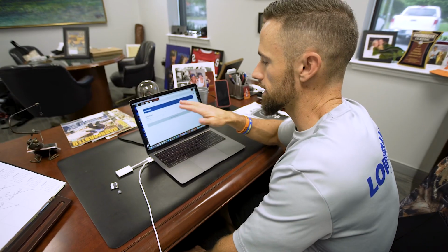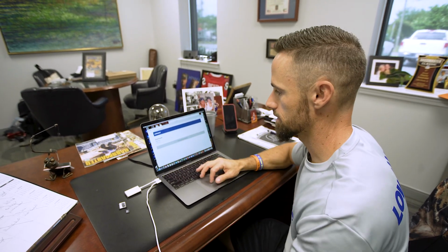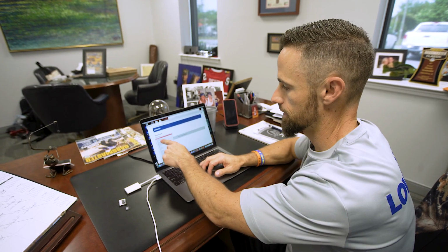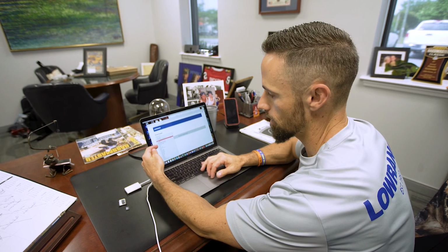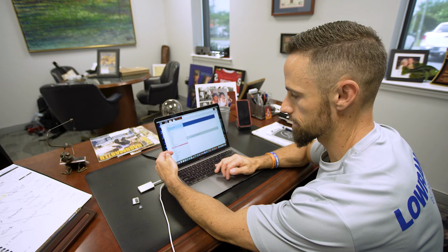All right, so I've got a Mac, and it doesn't matter if you have a Mac or a PC. Get onto a browser. I use Chrome. I like Chrome. You're going to go to downloads.lowrance.com. That's the website. You don't have to search around the lowrance.com website. Just go to downloads.lowrance.com, and it'll take you right to this screen. Very clean and simple. Then you're going to click downloads, and you see all the different options for the units that you can download the software for.